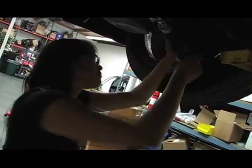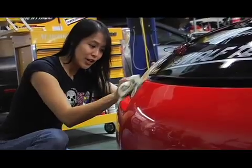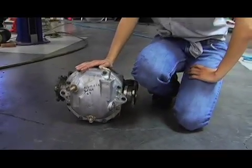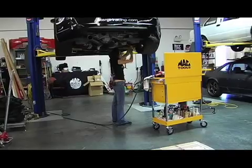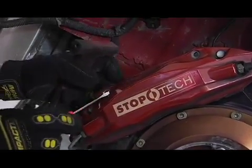A couple of changes made to the car since I drifted it to become a road racer: we switched out the LSD. I was running a two-way LSD and we switched it to a 1.5-way, so it's not as aggressive. I have KW suspension, which is truly double adjustable, and I'm actually using my crew chief's brakes from his car. I do have a long, long list of things to do.